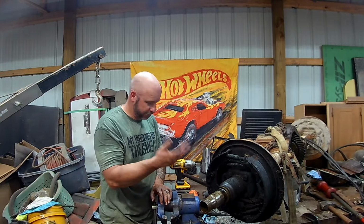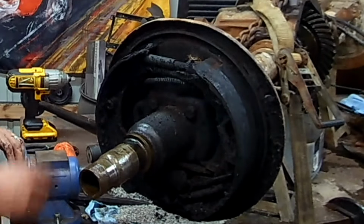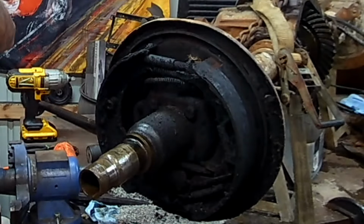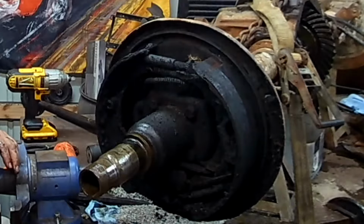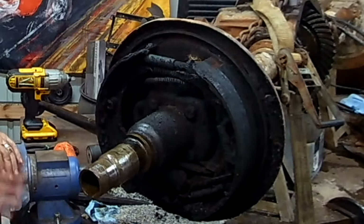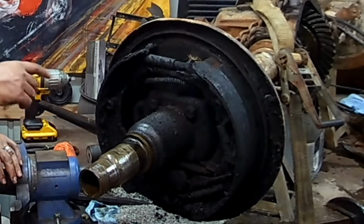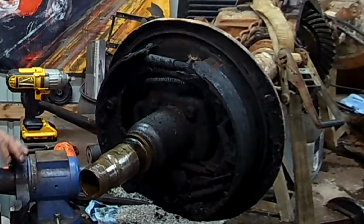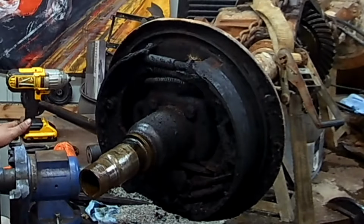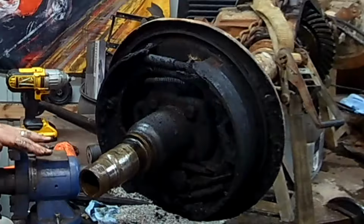So now I think we'll order a bunch of brake parts, because this has clearly been sitting in gear oil for a long time, and axle seals. Normally I'd say just run it, but I think we may as well put shoes and hardware on it. We'll see if we can clean the drums up, because I know they're expensive, and I'll probably do Rock Auto on all of it, because that's the only way I'm going to get it halfway cheap. This is a 1-ton rear end, and none of it is cheap.